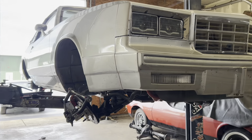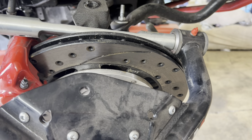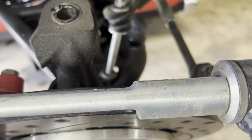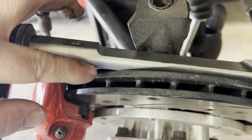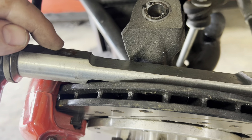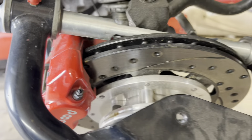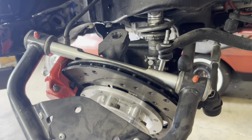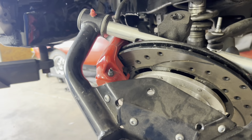Took the control arm off. These are the older style arms. The shaft — the inside edge — they had it the other way: the thinner side out, meaning this side is shorter and this side is longer. So when they had it in they had it the opposite way, making the ball joint stick out more. When this car was sitting on the ground you could see it. You can switch the shaft around for negative camber, positive camber, whatever. Took that out, switched it around, about to put it back in.